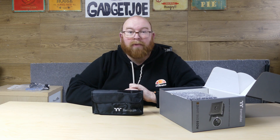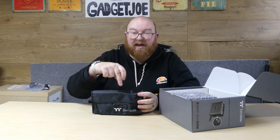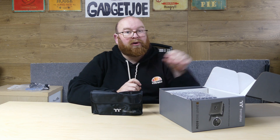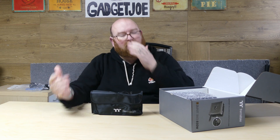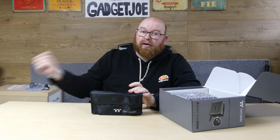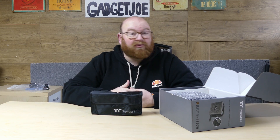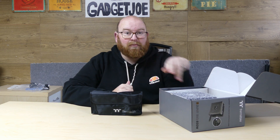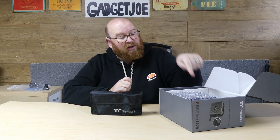The BM3 Smart range of power supplies is a semi-modular range. What that means is you get all the modular cables in the bag here and you can plug in exactly what you need into the power supply. Not only does it allow for a nicer, cleaner aesthetic, it also means you can plug in exactly what you need and what you don't need you don't have to put in there, thus making cable management much easier. You do have two cables coming out of the power supply that are permanently fixed into place, covered in a braided cable, which we'll look at very shortly.